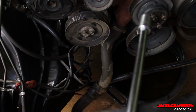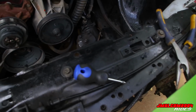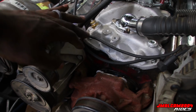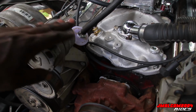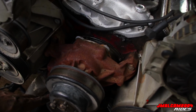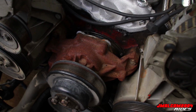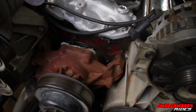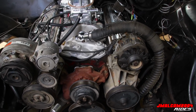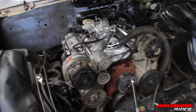a 3/8 wrench, if I remember right. Take those loose, then you can remove your radiator, remove your fan shroud, then you just take your belt loose. Release the tension with your 1/2-inch drive ratchet on the tensioner, take your belt off, and it's just 4 bolts, 9/16 bolts. 1, 2, 3, 4, then it'll pop off. Might need a pry bar or something, because it's probably seated on there pretty good. Water pump will come off. Then the installation is the reverse. You use your water pump gaskets, and then you put your bolts on, and then boom, boom, boom, boom, you're back. Just like that.